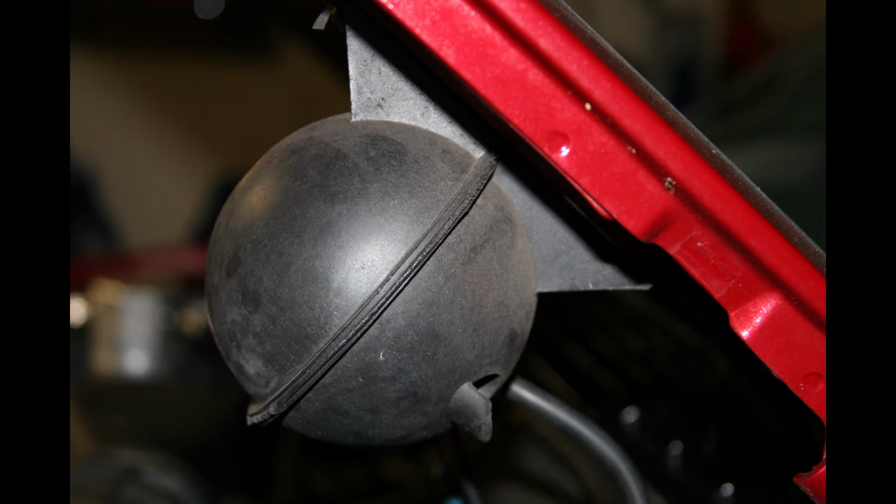If you have an older car that uses a vacuum-controlled air conditioning system and the air no longer blows out the proper duct, it blows out on the floor instead of out the air conditioning duct, then you might want to watch this little video. The newer cars use electric motors to control the doors in the plenum chamber of your heater and air conditioner.